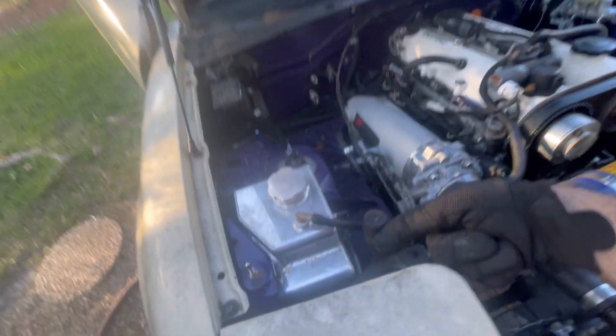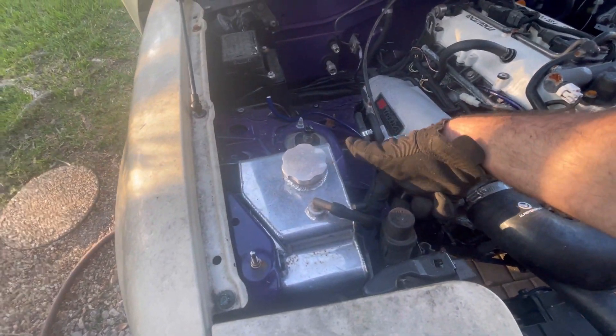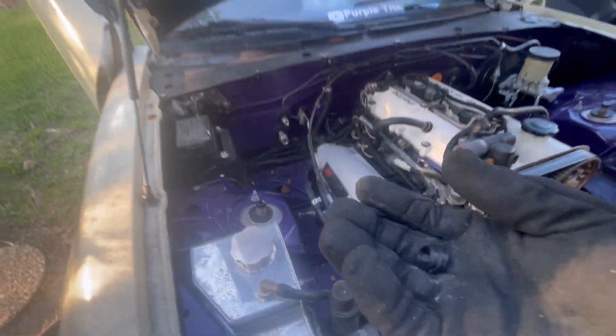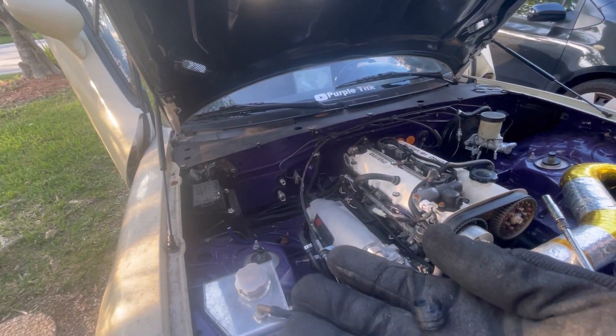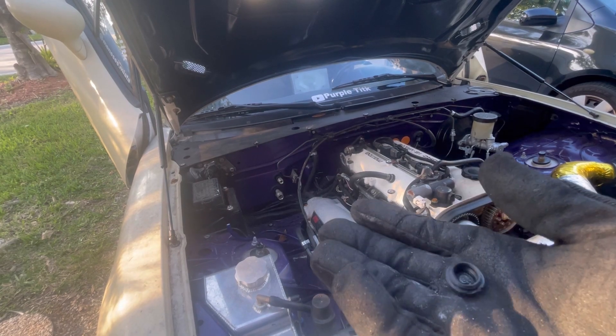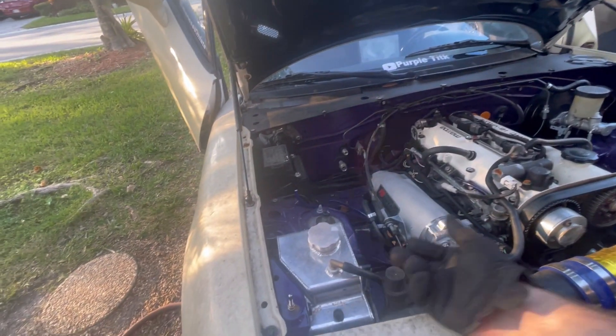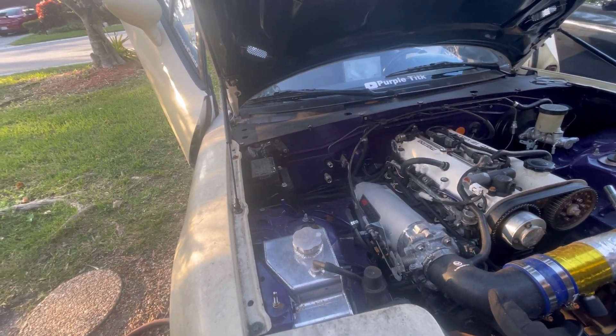As far as the pop-up being broken, it's a little bushing in this linkage arm. You can see it's broken there, and there's little pieces on there. This is one that I designed, so I'm going to go ahead and test it. Worst case, I'll just go buy new ones. There are a couple prototypes after this, so we're going to try to just push it on there and put it on.